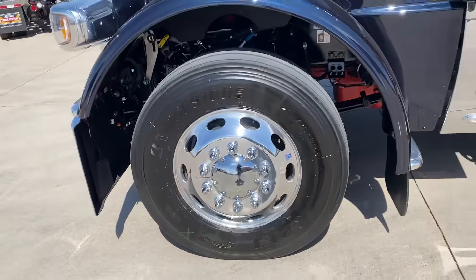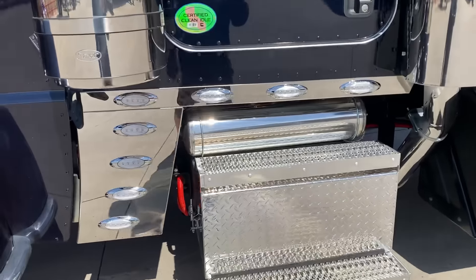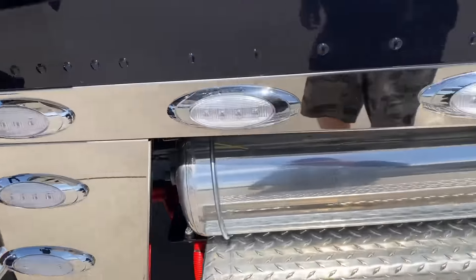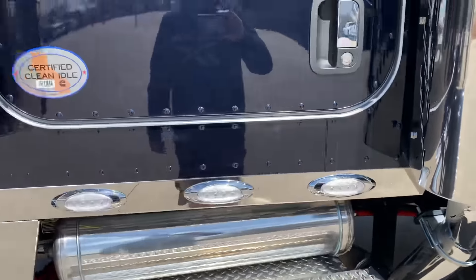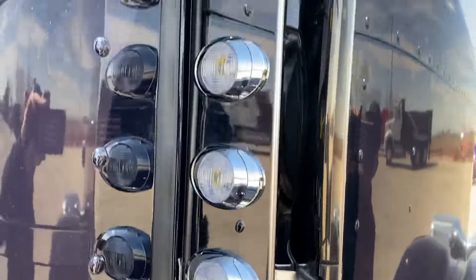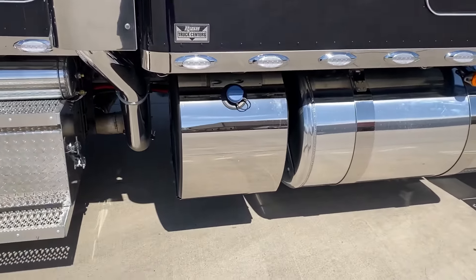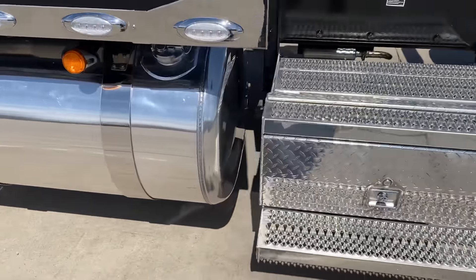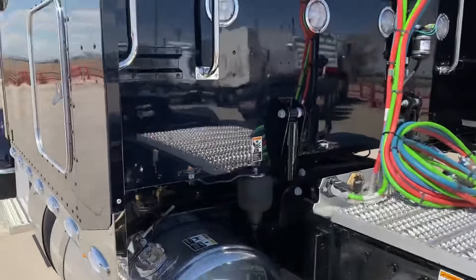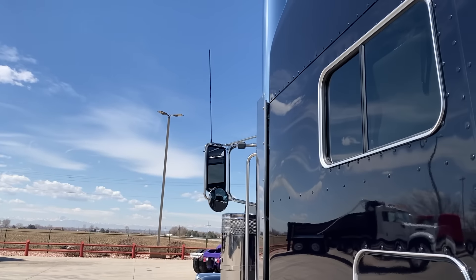280 inch wheelbase and this one's on Lowe Pro Bridgestones — Lowe Pro 225s, 295/75R22.5s. This is the way they come in to us; they already have the light kit on them. About the only choice we get, if the truck isn't built yet and it's far enough out, is what color we want. Lights in front of the air breathers — they do not do any behind and don't do any of the internal, but you do get the cab lights and the sleeper lights. They are LED; they look a little more old school. And a medium DEF tank, a hundred gallon polished tank there. Toolbox steps. These come with the bigger fairings. You can see they put the CB antennas on the mirror brackets.